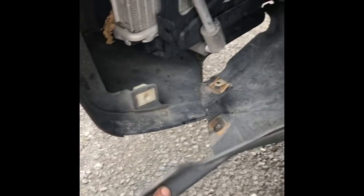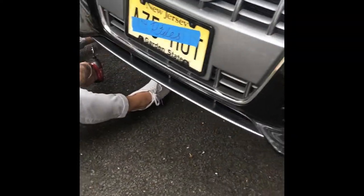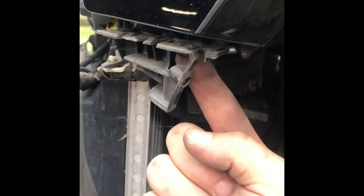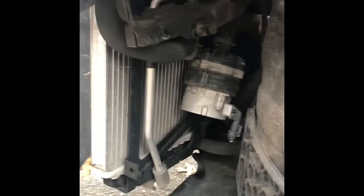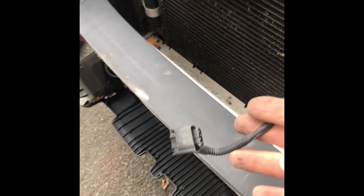We peeled back the inner fender well - 10 millimeter right in the corner - got that off. Now we're starting to take all the protective plastic piece on the front bumper off. There are two 10 millimeters: one up here and one up here. When the bumper's on it's impossible to show you, and then in addition you have another 10 millimeter that threads in through this hole and connects the bumper to the metal fender to cinch everything up. Then aside from pulling off your fog light connectors and the sensor mounted in the middle of the grill, the whole bumper comes off in one piece.